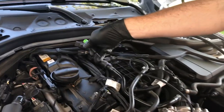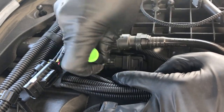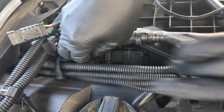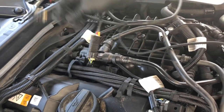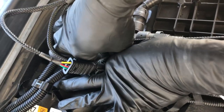The next connection is the map sensor, which is up here. It's a little trickier to reach on this car, but it is right at the top. You'll again pop the clip out, and then you'll either lift it from the back or push it down from the front to slide it out. Once you get it out, you'll plug it into the JB4 connector. This is probably the trickiest part — you plug the JB4 back in there because it's at a tight angle. If you kind of hold the wires out of the way with one hand, you can pop it in there and then it slides in.